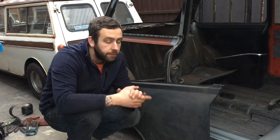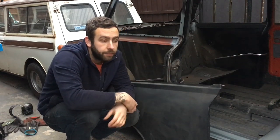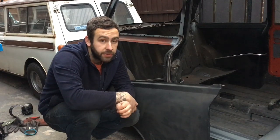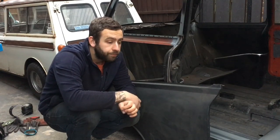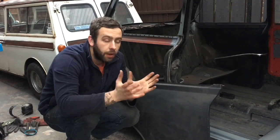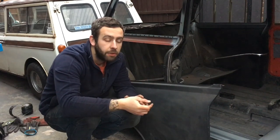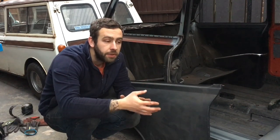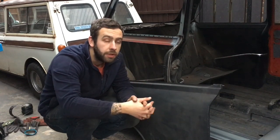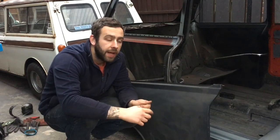In an ideal world I want a spot welder to do all this - it's something I really want but also something I cannot afford right now. This is going to have to go on whether I've got a spot welder or not - I'll plug weld it like I've done everything else, and then this will be the whole side of the car done, other than the front end which we're going to do last. The back only needs the valance that I know of, and probably some repairs once I take that off. Thank you for watching - I hope you've enjoyed the episode. Please go see my giveaway and I'll catch you in the next one.